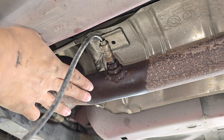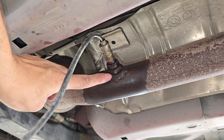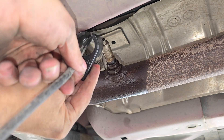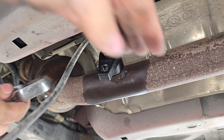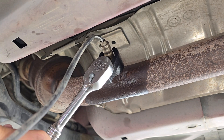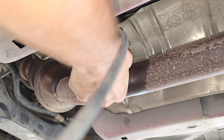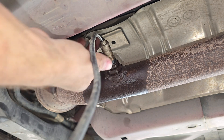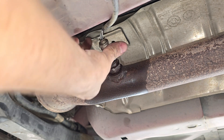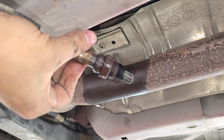I don't know the torque spec, so we're just going to get it tight. It'll be a 22 millimeter — you can either use a wrench or a designated O2 sensor removal socket. We're going to slide this on here nice and snug, grab the wrench, and loosen it up to get it loose. I'll note I've already loosened this before filming so it's easier to remove on camera. And just like that, there's your oxygen sensor removed.